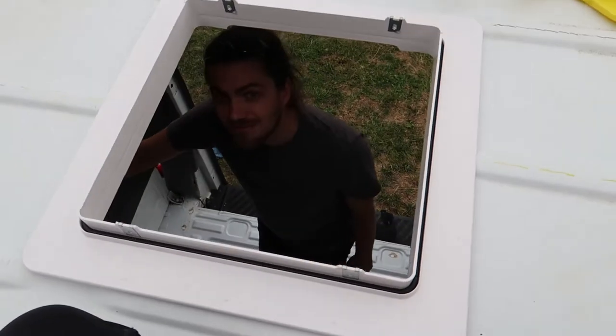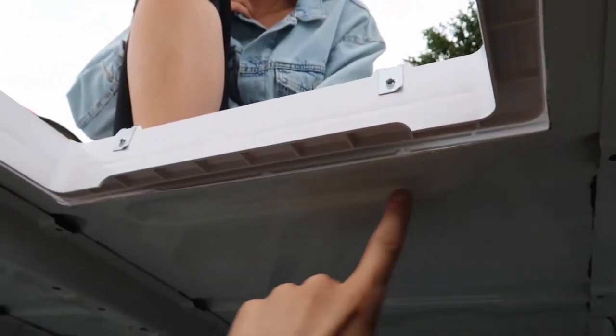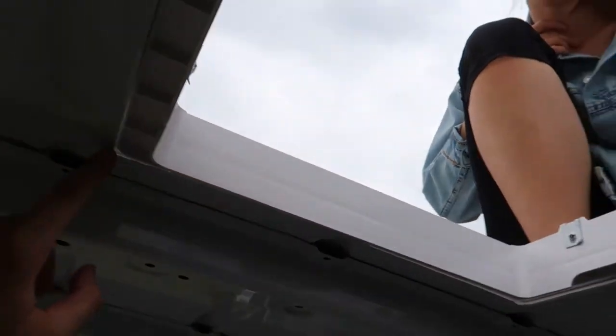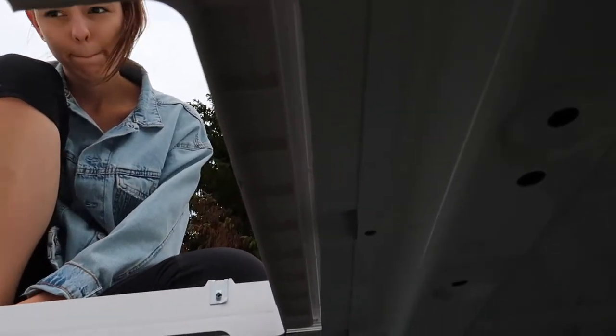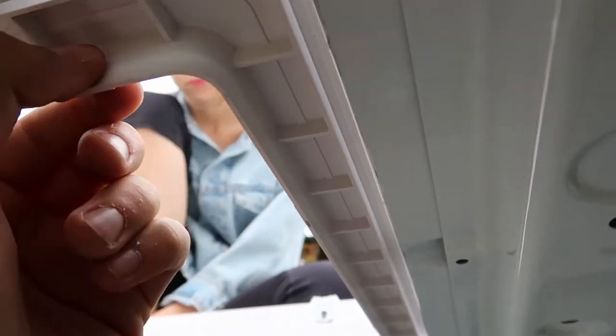We have a hole! But this was also our second or third mistake during the build. We cut a hole for the European size — 40 by 40 centimeters — hoping the fan flange would fit nicely, but because of all the recesses in the roof that's not possible. What we should have done was cut it to the US size. If you're doing a Sprinter van conversion and want to install the European MaxxFan, I'd recommend cutting it down to 35.5 centimeters and filling the gaps with putty tape.